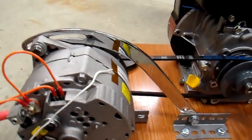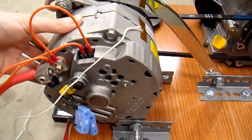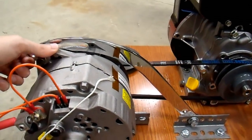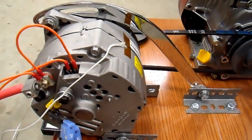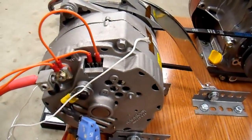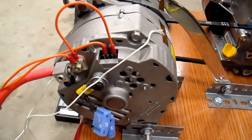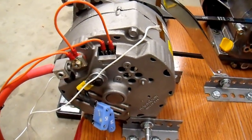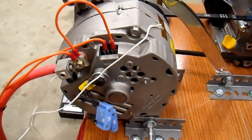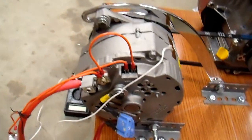I had trouble getting the output current I really wanted out of this alternator. In my last video it was about 80 amps at full engine speed and about 70 amps at the speed I wanted to run it, and that wasn't really acceptable to me. Also the alternator I was using had some minor issues — the bearings weren't perfect and it was very old, hadn't been used in a long time, and I suspected it was an 80-amp model. So I sold that 10SI alternator since it's of no use to me and could be useful for somebody else in an actual vehicle.